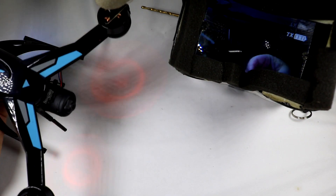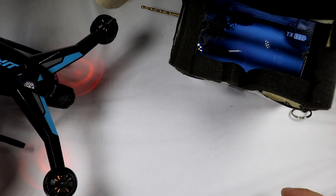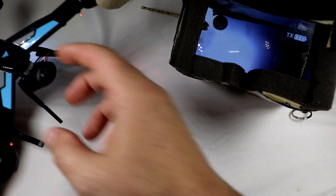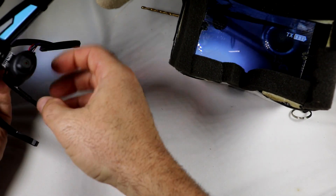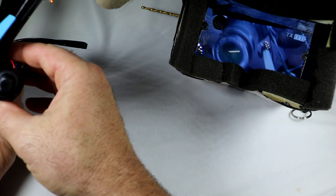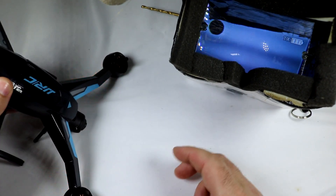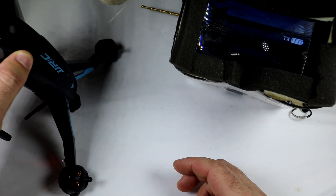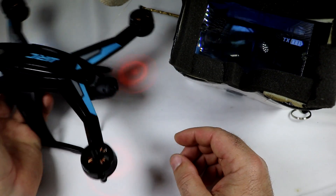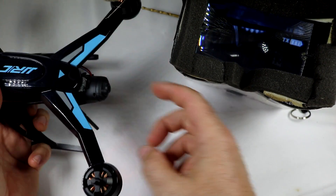It's still a very good option to be able to try FPV. You probably don't want to be doing this in low light - you want a really nice sunny day - because this type of camera does get kind of dark and the dynamic range isn't very great with these kinds of cameras. It's a really light camera - I think the whole package here with the transmitter is about 10 grams or so, so it's not going to add barely any weight at all to your setup. If it does crash, you can see that the arms are going to hit first - the camera won't really be able to hit the ground. The legs will hit and the arms will hit before the camera hits, maybe just the antenna a little bit. So it's a really good option if you have some cheap cameras laying around from other cheap quadcopters - this is definitely an option as long as the plug is correct.